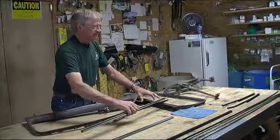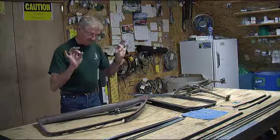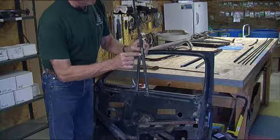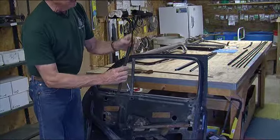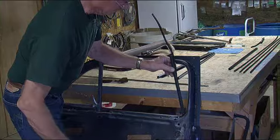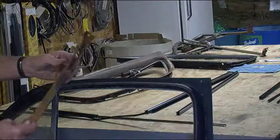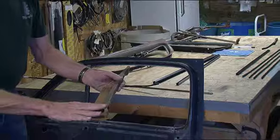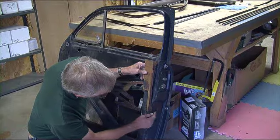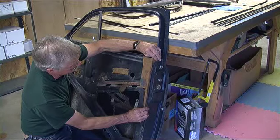Anyway, that's what you get in your kit. Now the bat wings — the batwing has a little clip here and a clip here, and of course this nice long tail. The batwing goes inside your door and clips into what we call the hourglass bracket. This hourglass bracket does not come in the kit; it's part of the door. One screw hooks here and another hole takes a screw which holds the bracket in the door — that's what holds this bracket in.